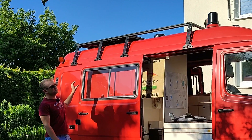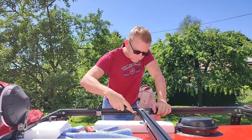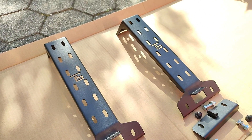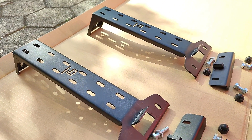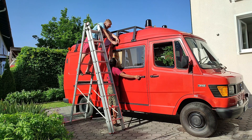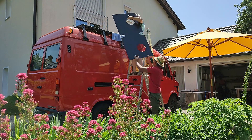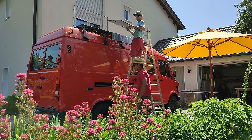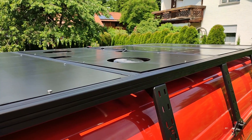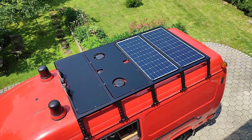The only problem now is that my roof rack looks totally unbalanced because I had to move the brackets back, and of course that's nothing I can accept. So I bought one more aluminum profile and two more brackets from TS Tigris Syncro. The additional brackets are fast to install — I recommend using a piece of thin rubber, maybe from an old bicycle tube, between the brackets and the van to avoid scratches that might turn into rust later. Additionally, we install 9mm resin-coated plywood panels painted in satin black in the front area of the roof rack. That has two reasons: first, the shadow on the roof might help keep the interior cooler; second, I prefer a homogeneous dark surface up there so the van looks cooler on drone shots later. With the additional set of brackets the roof rack looks perfectly balanced again.